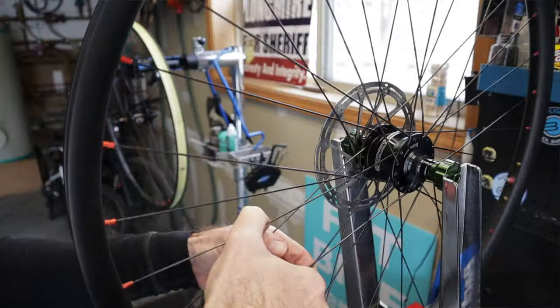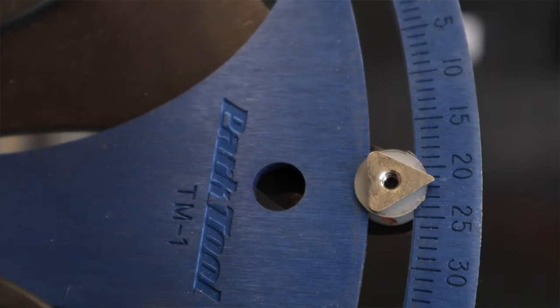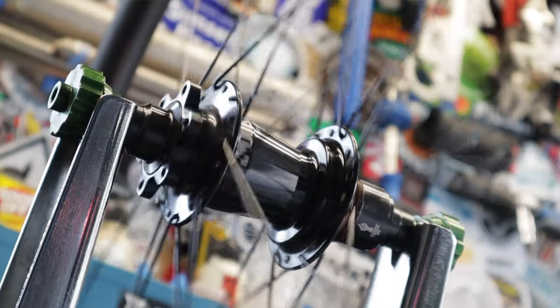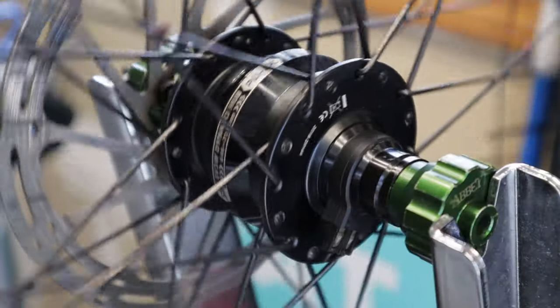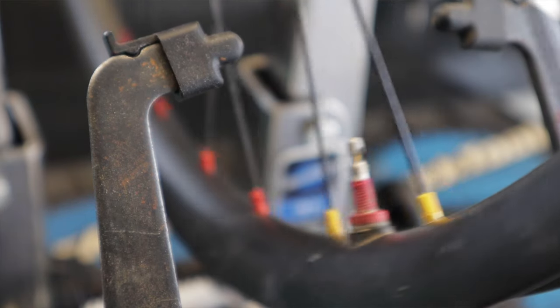When rebuilding Sunny to the spec of my stolen bike, I decided to do pretty much everything the same. I built a second pair of custom wheels: Nox Teocali carbon rims laced to an I9 Torch hub in the rear and an SP dynamo hub in the front, double-butted spokes, red alloy nipples with a couple gold nipples by the valve stem. The wheelset is bomber. Unfortunately when I went to buy a new dynamo hub, they were completely sold through.